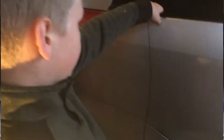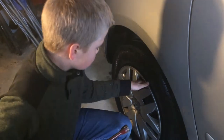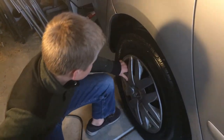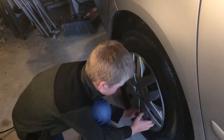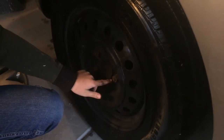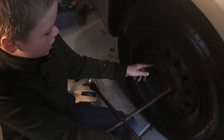The first step to replacing the brakes is to take off the panel — the hub cap. It might be a little hard to take off but it comes right off. Then you've got to take off the nuts on the wheel. You only have to loosen them, and you have to do this before you jack it up, because if you jack it up first and try to take off the nuts, the wheel will just spin.